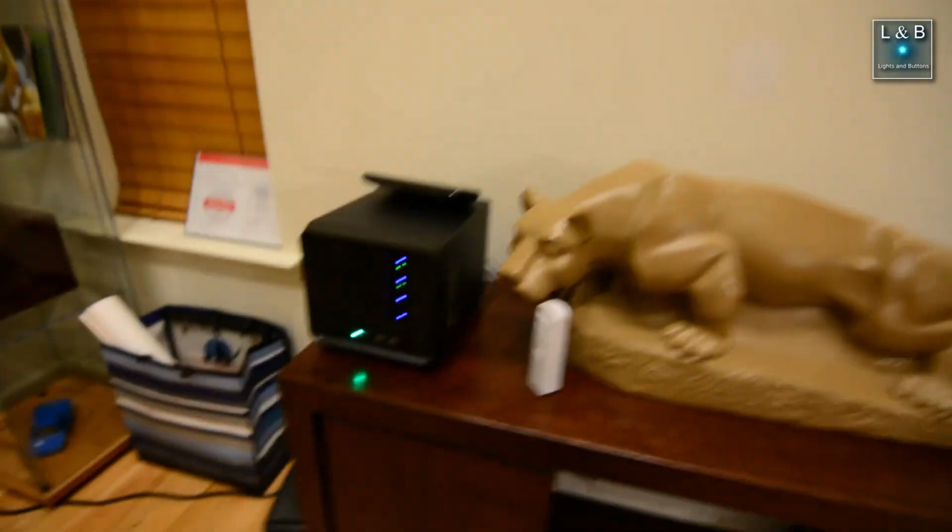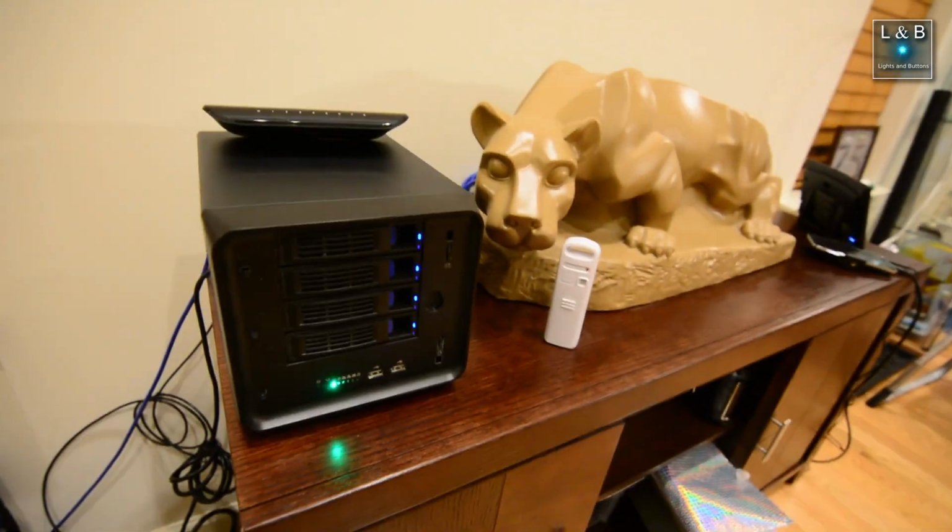So in order to use my processor on the motherboard that I have, I need to upgrade the BIOS. But in order to upgrade the BIOS, I need to have a working processor. So that's a bit of a catch-22. I have another machine that can possibly donate a processor temporarily for this to happen. So what's that machine? That's my home server right there.